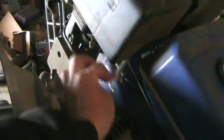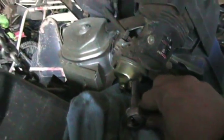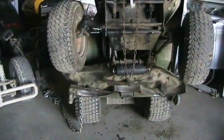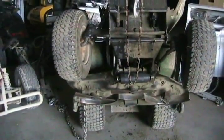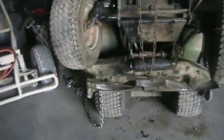This is the throttle. I never even bothered running a cable — I can just reach that with my arm and set it wherever I want and drive. Now that I got all that cleaned out of it, the next step before I start anything in the spring, especially for clumsy lawn mowers, is drain the bowl. If you want an easy start, fresh gas sure works — they almost never start on last year's gas in there.